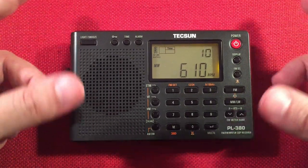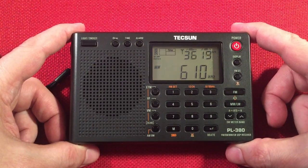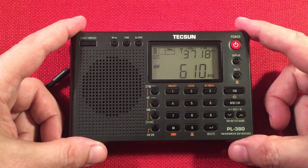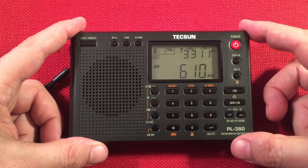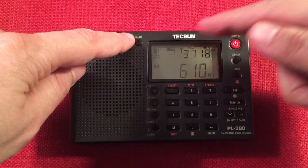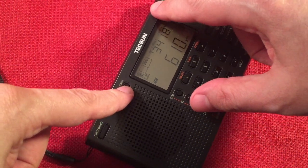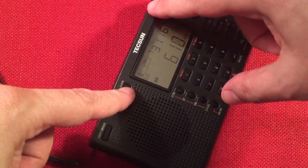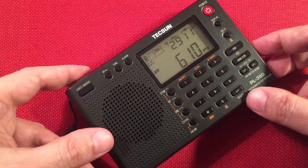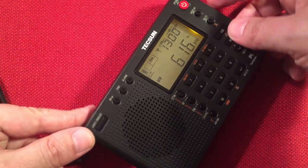Of course, for those who don't know anything about AM or medium wave and are curious, and the first time seeing this radio in action and don't know much about portable radio, there's an internal built-in antenna. That's what's picking up the signals, and it's a lace-like across here. It's like a long ferrite bar wrapped with a coil of wire, and you aim that horizontal edge towards the station to get better reception. That's why I keep turning it. Some people ask. Most of the people watching my channel know that, but a few don't. Let's keep going.